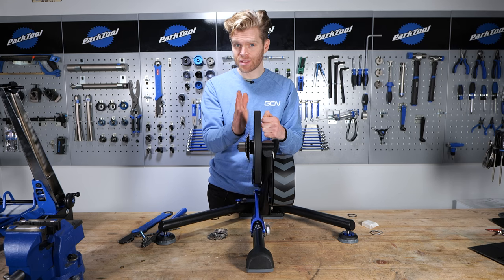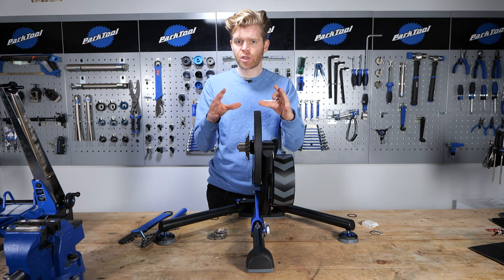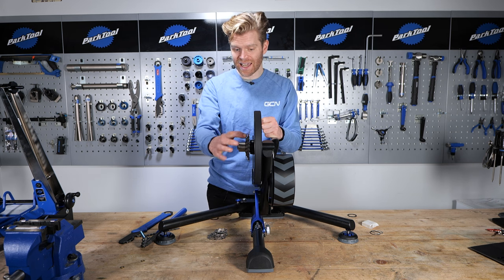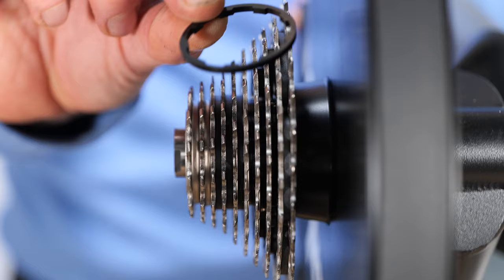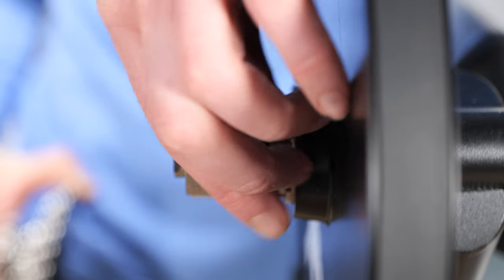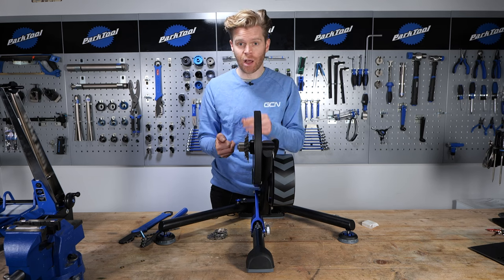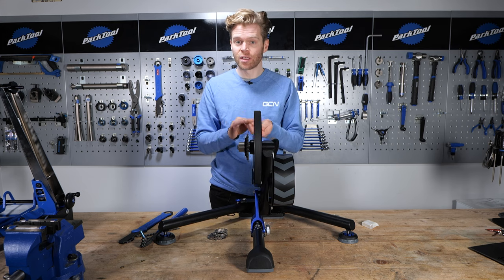To establish which cassette you need to space more outboard, you'll have to do a bit of research and testing on your two setups — on your bike and on the trainer. If the gears on your bike are working absolutely perfectly, but then when you put the bike on the indoor trainer the shifting is reluctant or difficult or is clicking when it's trying to get into the biggest sprocket, then you need to adjust the indoor trainer's cassette and shift it slightly outboard. This will require a little bit of trial and error and you might need to use some different sized spacers. The nice thing about that little spacer kit is it's written on them what the sizes are. It starts off with just a one millimeter fixed spacer — I would start with that, see what the result is, then switch to a 1.5 millimeter spacer and so on. Eventually you'll get to the right point.